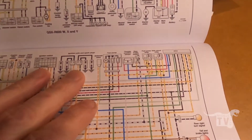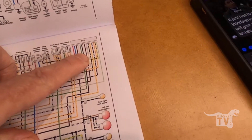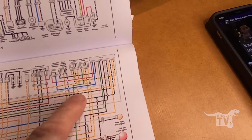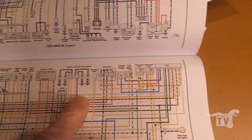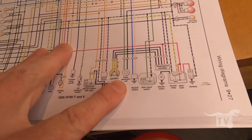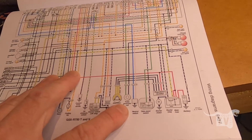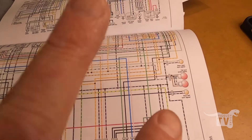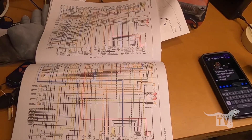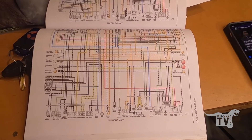I've been doing some investigation on the wiring diagram. Those two frayed wires — the orange with the red marker — goes from the ECU across to the ignition switch, and the green one that's frayed, if you follow the diagram down, joins up to the pulse coil generator. I have a sneaking suspicion that if both of those things are interfering with each other, that may be what's causing the hot start issue. So I'm going to fix those wires, put a new battery in it, and with any luck the problem will be solved.